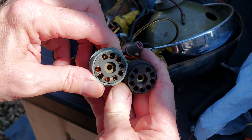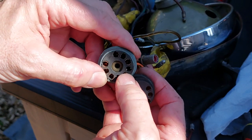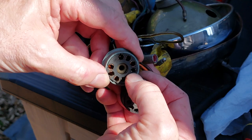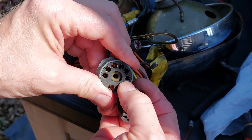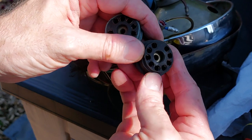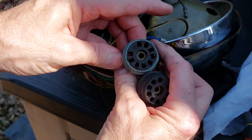These plugs had had it. I don't notice too much when you first look at them, but then you notice there. Can you see, obviously the connectors have gone and somebody's stuck a piece of wire in to replace the connector, and there as well. Yeah, and they're quite corroded, I think, on this one there. The terminals there and there are pretty corroded. And they're quite spread apart.